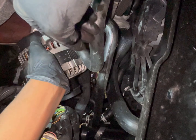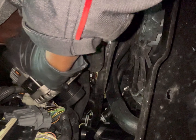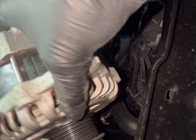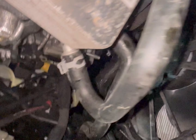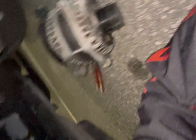I had to just wiggle the alternator out. I kind of thought I was recording when I first took it out but I guess not — I put the phone down and it must have stopped. When you're wiggling this out, you just don't want it to smack you in the face when it comes down. It sits in the housing right here — that's where it came out from. One bolt here goes into that stud there and it comes out from underneath, not on top.